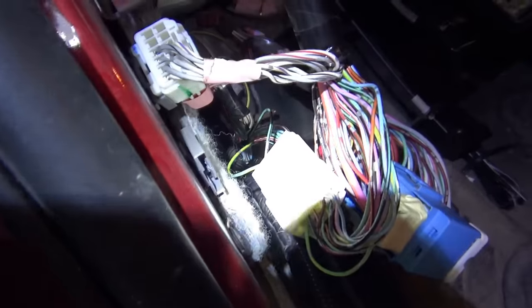Quick follow-up on the 2007 Mazda CX-7 no-crank disaster car. When I left, we determined it needed a new transmission control module to crank — the module was blown, and so was the four-wheel drive module. And why was the alternator replaced? Pieces of the puzzle are coming together. My hypothesis: at the first shop where they did all the suspension work, I don't think it was welding that fried the modules — I think they tried jump-starting it backwards. Reverse the polarity — boom. Your alternator gets cooked, and in this case some modules got cooked as well.